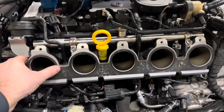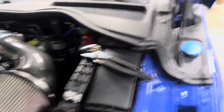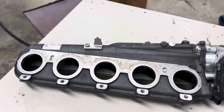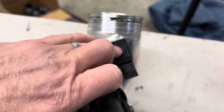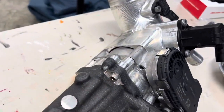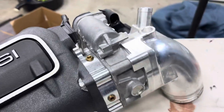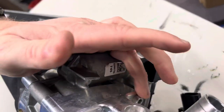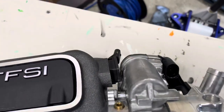The upper manifold is off — you can see the factory gasket and the manifold over here. It's a T25 to take off the factory MAP sensor there. Then you have to remove the throttle body — there are four bolts holding it in, two on each side. You have to remove this whole assembly so that you can access that MAP sensor.